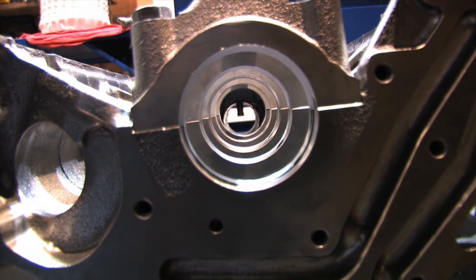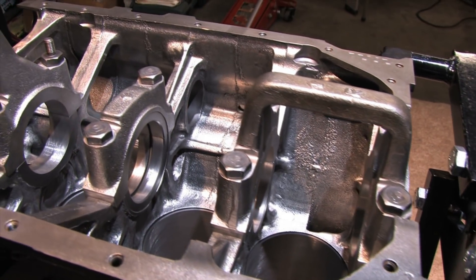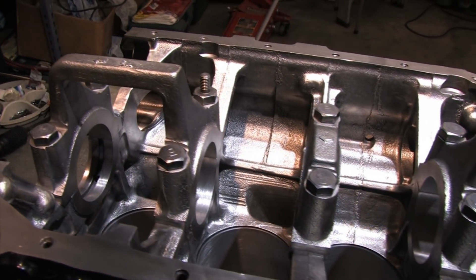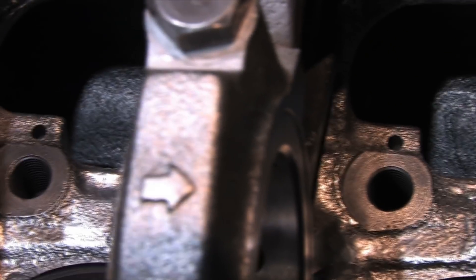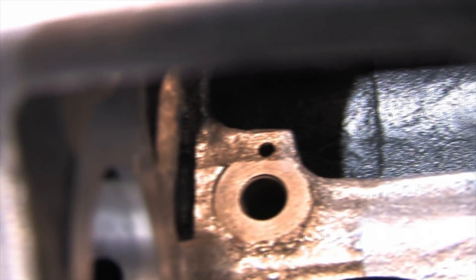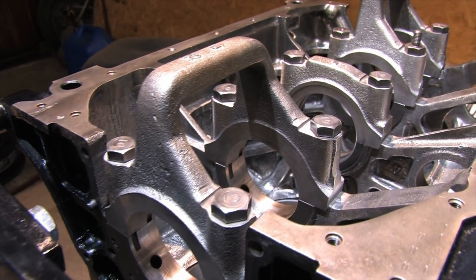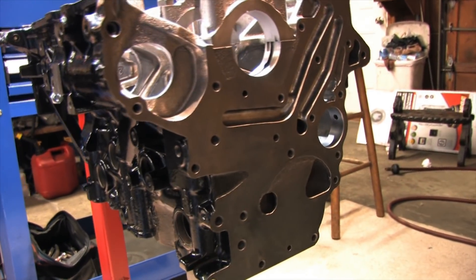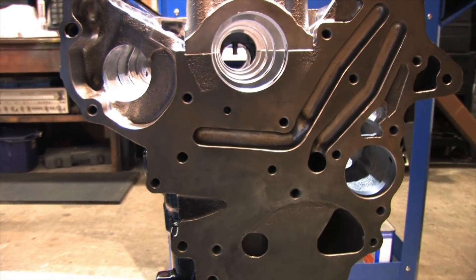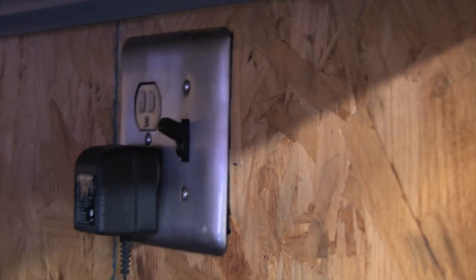And here's what I've come back to. This is the cleanest used engine I think I've ever achieved, and these are crucial preparation steps for the crazy thing I'm about to do. If I wasn't using this engine the way I'm going to use it, I'd never go through this kind of effort — I'd be putting bearings, crank, rods, and pistons in it right now and putting it right back to work. But according to the label of the product I'm using, I've got to keep going with the cleaning prep. Mineral spirits was just the degreasing phase. Now I have to clean off any residue that surfaced after the mineral spirits evaporated. Denatured alcohol is a residue-free solvent — it's not as effective as petroleum-based solvents for degreasing soiled engine parts, but it does a great job loosening and removing dirt and oil so it can be wiped away before it evaporates, leaving behind no residue. Industrial painters often use it to clean and etch surfaces they're about to paint to help the paint penetrate better and to prevent fish eyes from dust or chemical contamination.